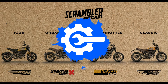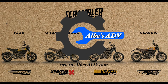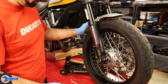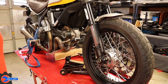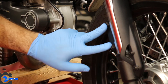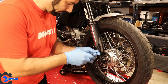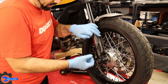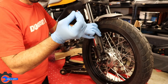The first thing I'm gonna do is remove the fender and the protector for the front fork over here. We have a four millimeter allen key and we're gonna remove those bolts over here, this one, and those two in the back, and then we're gonna go on the other side and do the same thing. There is some thread lock on the bolts so we need to remember that.